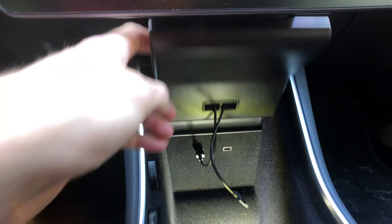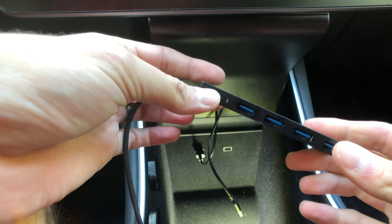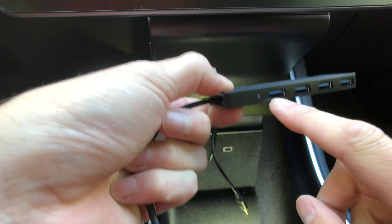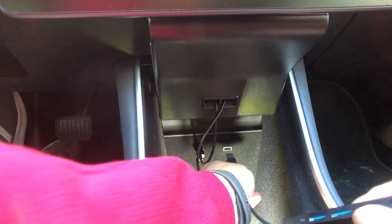What you'll need for this is a SATA connection that goes into a USB. I got this online with a kit to clone a hard drive — to make it easier to swap from a spinning hard drive to an SSD. It just plugs right into those right here. Plug that in and we have the USB end, so now this is all connected. There are two USB ports down here for the charging outlets. I've unplugged the passenger side one, and you can plug it right into that. If you want to use a USB hub, you can plug in your charger and also plug in the SSD.